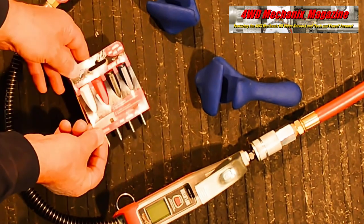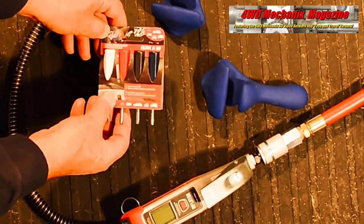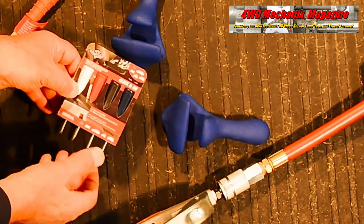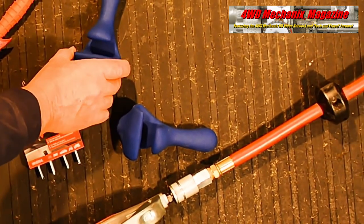The Gaither Click and Go valve core tool mechanically locks the valve core in place so valve cores don't get blown across the shop when deflating a tire. This makes it much easier to install a core, and there's no magnet, so there's no chance of it interfering with TPMS.